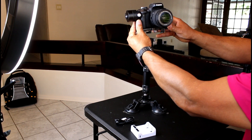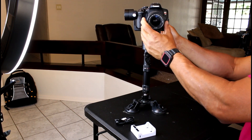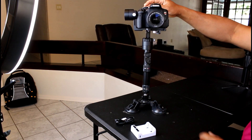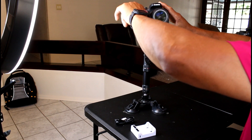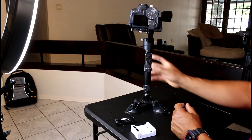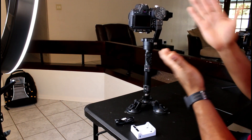If it's going down this way, bring it back until you get it where you want it. I'm a bit off this way, so I'll open the knob at the back — it's looking a bit down this way — and bring it back a bit. That's better. Now lock it in. Remember, while you're doing this, don't turn on the gimbal — you don't want to put any stress on the motors. Close it up, make sure everything that needs to be tight is tight, then turn it forward until it looks straight.